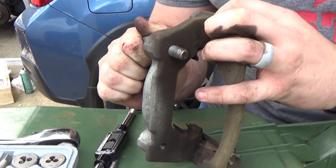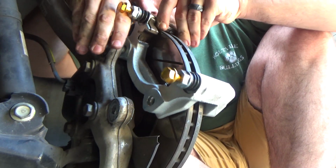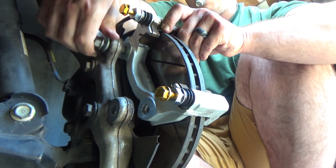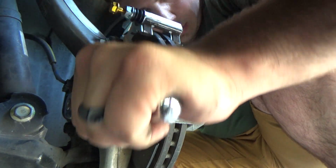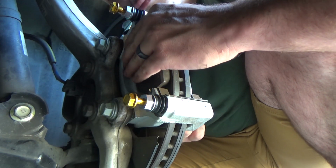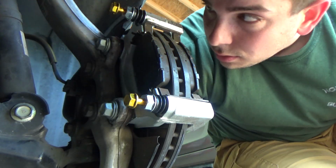I would like to point out that this vehicle was bought used from a private lot, not from a Lexus dealership. My theory is that they turned the rotors prior to sale knowing that they had severe shaking when pressing the brake pedal, but they did not investigate to see why the rotors were warping in the first place. Knowing that it would soon be off the lot and become someone else's problem, they just did the easy thing. That's why it's important to diagnose problems and determine root cause. Anyone can change parts, but a good mechanic should know how a system works and follow basic troubleshooting guidelines, which, by the way, are spelled out pretty clearly in the dealer manuals, and basically anyone could follow them.